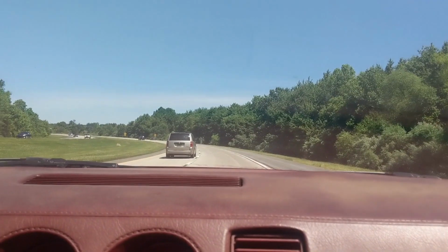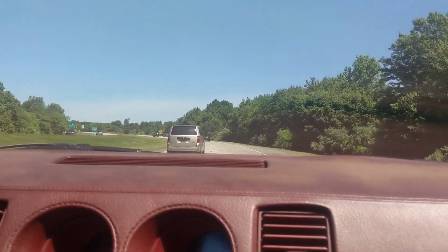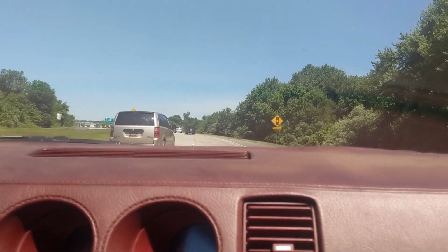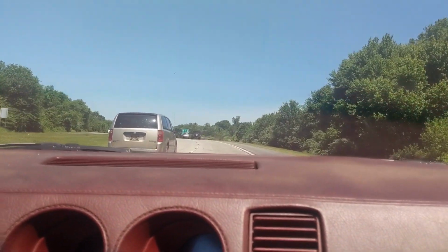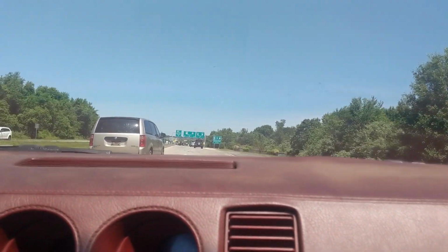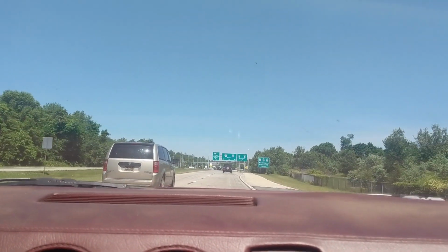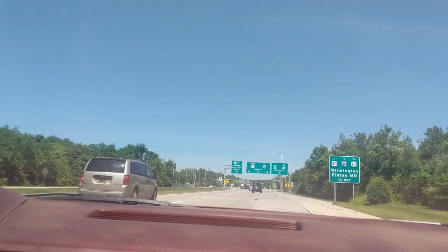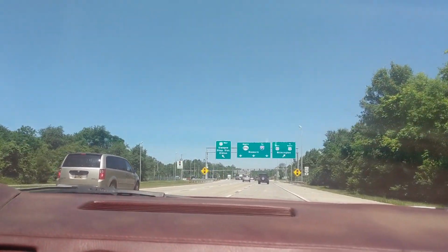These cars are pretty light too, so they have a pretty good power to weight ratio. I think this one probably weighs about 3,200 pounds, because the iron block LS is about 100 pounds heavier than the old VG. If you put an aluminum 5.3 in here, or an aluminum block LS, whatever, it should weigh about the same.